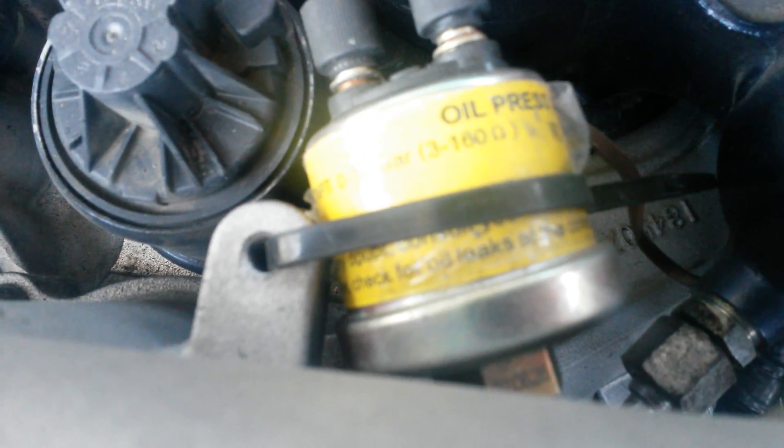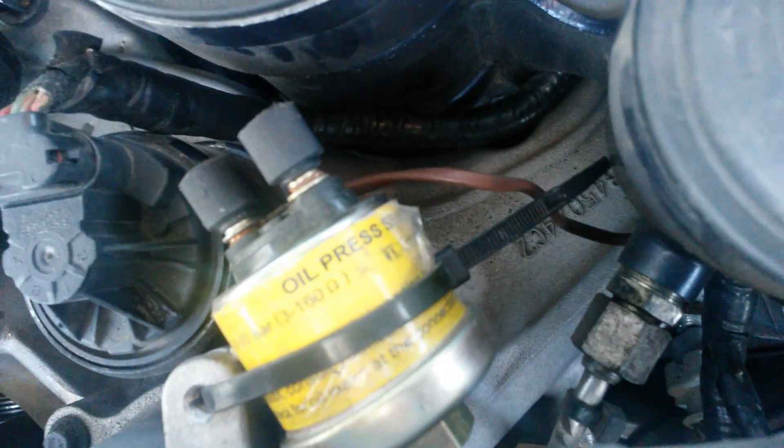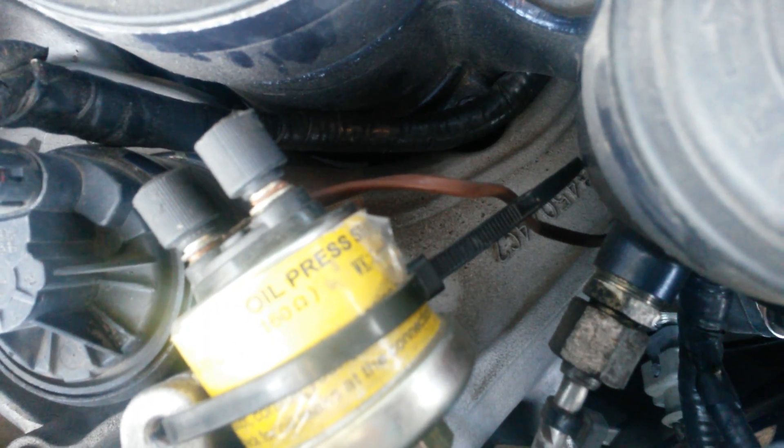I've basically just got it wrapped around with the 1/8 inch grease gun whip going through that little eyelet there on your intake elbow. I was doing this really cheap — I've got less than $30 in the whole gauge setup. I used some spare thermostat wire I had on a spool. It's a solid core wire so it just bends. It's not braided so it's not as flexible as it could be, but it is insulated. You're just going to run that along your main engine wiring harness.